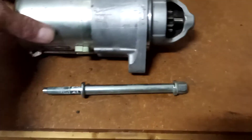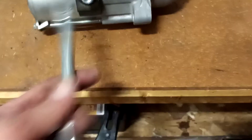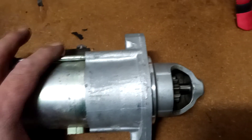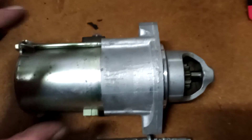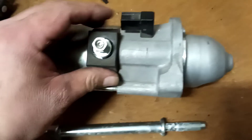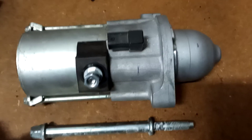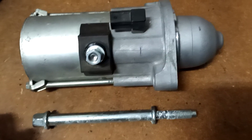This is what your Honda starter will look like - there are your electrical connections. This is that extra long top bolt. Now I'm going to bench test this starter. One thing I want to point out is I have had starters that, while installed on the car, would not want to work but would then pass their bench test. Starters can be hard to diagnose, especially on these cars with push start buttons. There's also a brake switch involved that you need to make sure is okay. But I'm going to bench test this starter and then more than likely get another starter installed, and that should fix this problem.